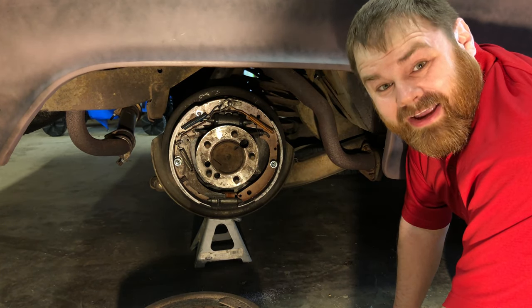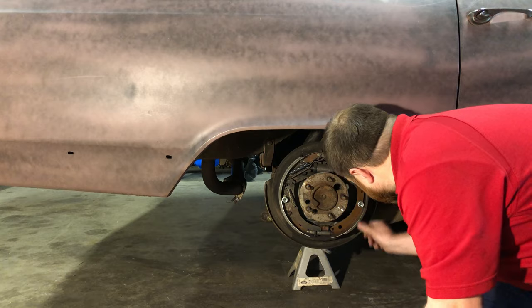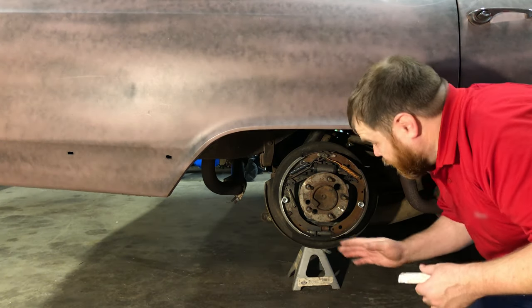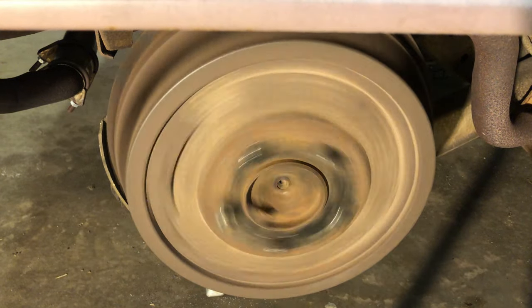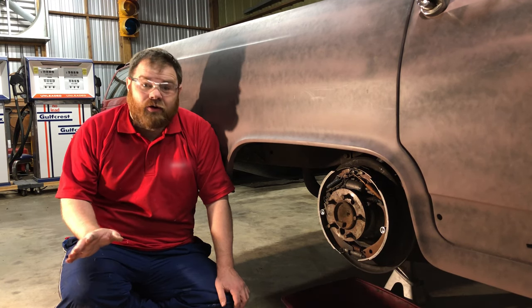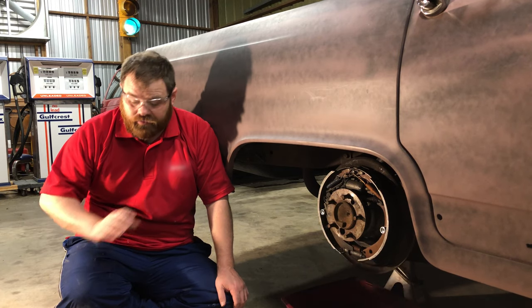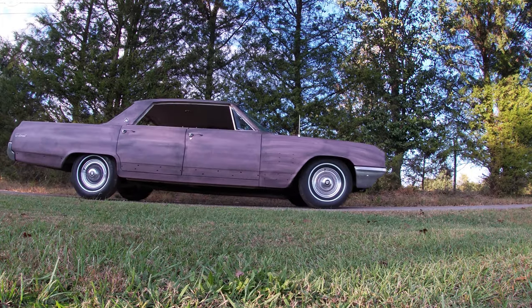Let's bring out the die grinder. The side's cleaned up nicely and there's no more ridge, so we're going to chalk it again and give it another test. I took a little break to compare before and after video to make sure I wasn't seeing anything that wasn't there — nothing is rubbing. Now it's time to give it a bath, get that drum back on, and take it down the road for another test. Let's do a threshold braking test and see how we did. No locking up — we're good to go. Thank you for watching.